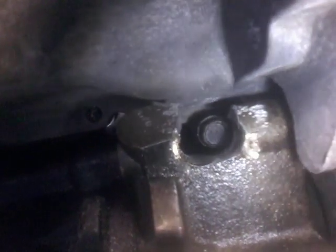And then you can see right above that is your bolt. I'm going to shine the light up there so you see your bolt up there, and you're able to access that. So now what you want to do, as you notice, I drilled a little bit too far over to the right. Drill more to the left. Drill a little bit more to the left of this housing right here, of this bracket, and that bolt will be nice and centered. So I widened it up, and I'm able to fit a 13 millimeter socket in there.